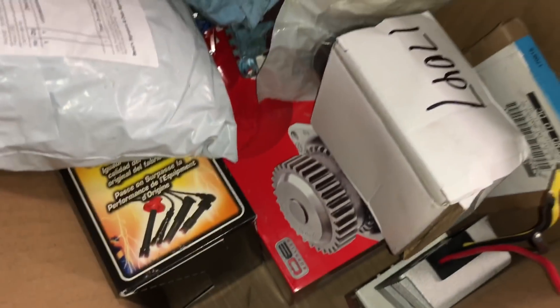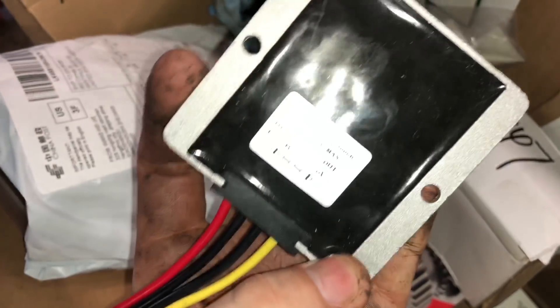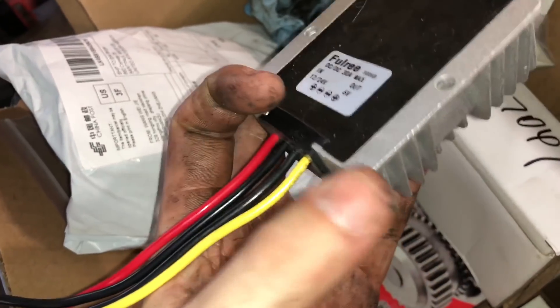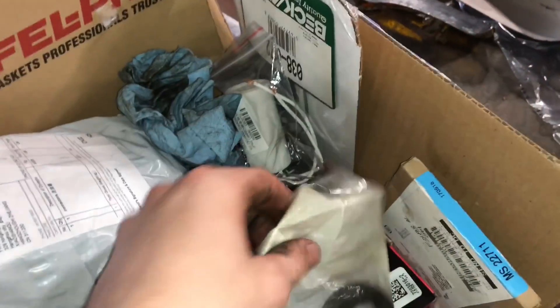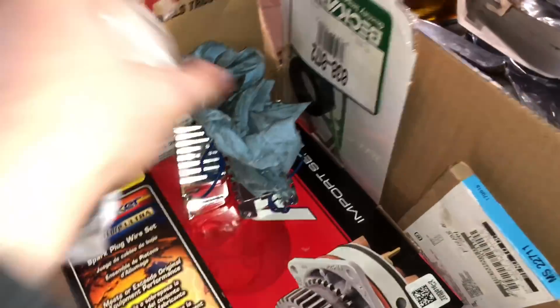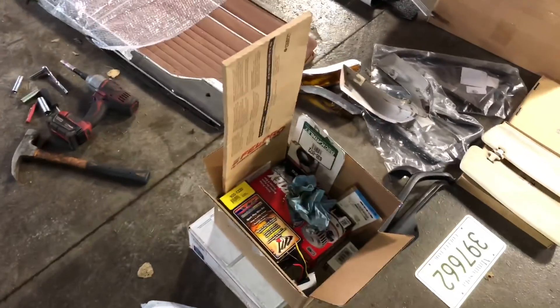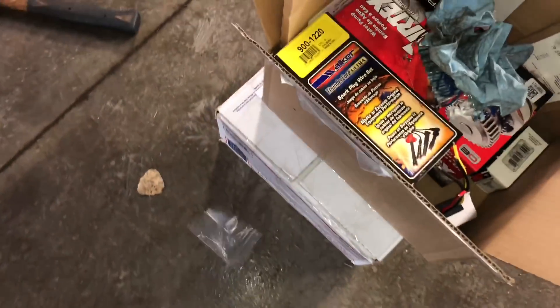I've got a water pump. I've got a couple of voltage reducers — this is 12 volts in, 6 volts out, and it can take something like 30 amps max. I'm going to use this for the HVAC and the wipers, so the bigger draw items that still need 6 volts. For smaller items I've got individual converters that can take 5 amps each. I've got a lot of options. I'm just trying to retain as much of the 6-volt car as I can while still maintaining the 12-volt flexibility and ecosystem for the ECU. Never dealt with a 6-volt car before — probably will never again.